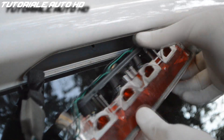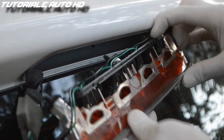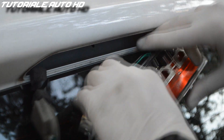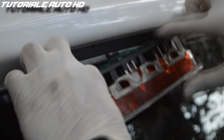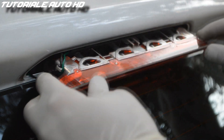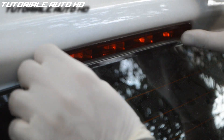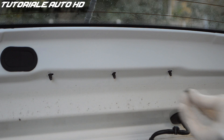Put back the holder and press it until it's locked. Clip back the wires. Arrange the lamp into position. Now you can tighten the nuts.